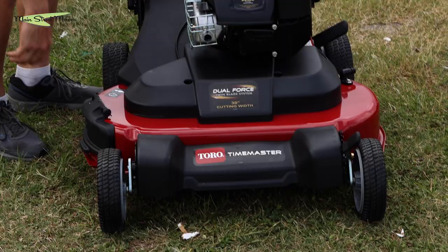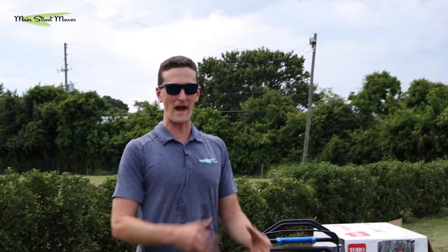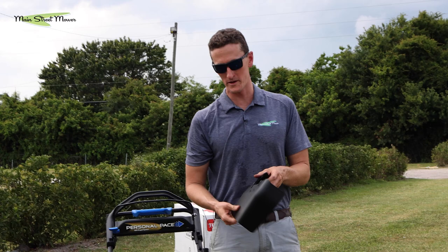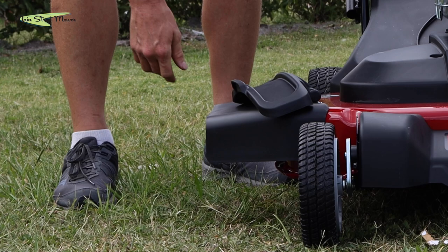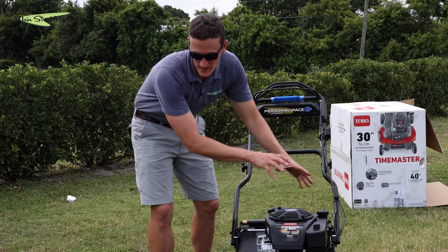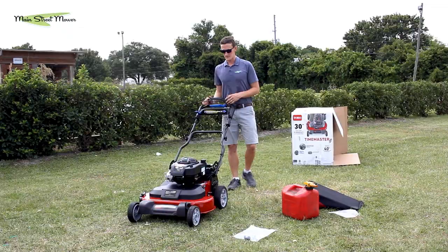In the current setting the back chute is closed, the bag is off — it's a mulching or recycling mower, taking the clippings and chopping them over and over until what's left behind is just like a grass dust. These are three-in-one mowers. They'll mulch as they are now, or side discharge — all you have to do is open this door and put the side discharge chute in like so. A spring-loaded door applies pressure to keep it in place. If something happens to it you have high-speed projectiles flying out, so get it replaced before operating again.